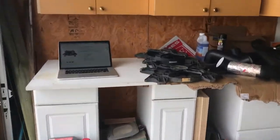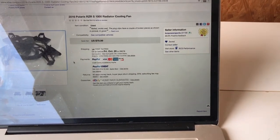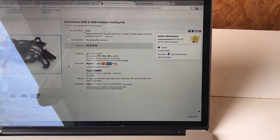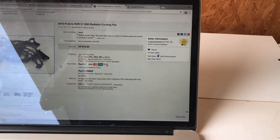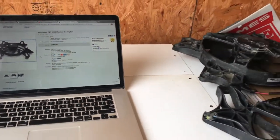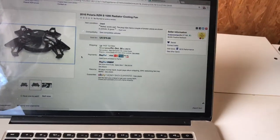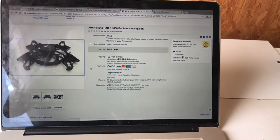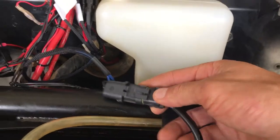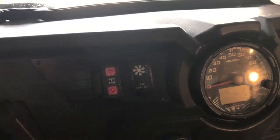I just wanted to let everybody know that the radiator fan off of the RZR 1000 will work on a 900 Trail, and it seems to be a more powerful fan — I think that's pretty cool. I'll do a follow-up video. It was a lot cheaper than buying a new fan. I do have the override switch on it — that relay right there — and I'll do a separate video on that.